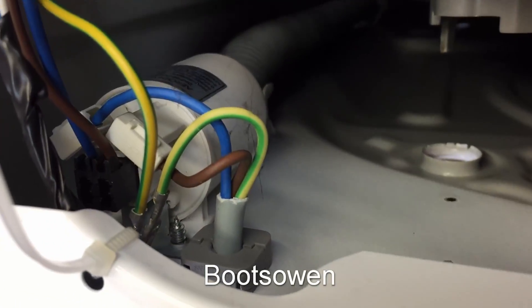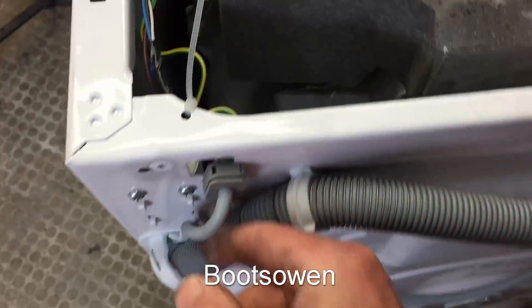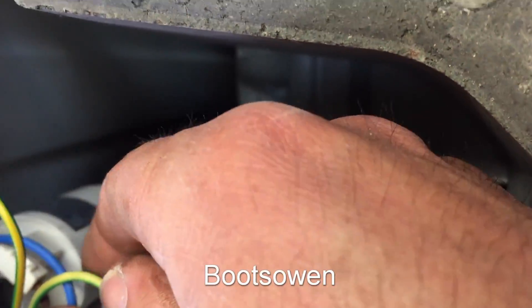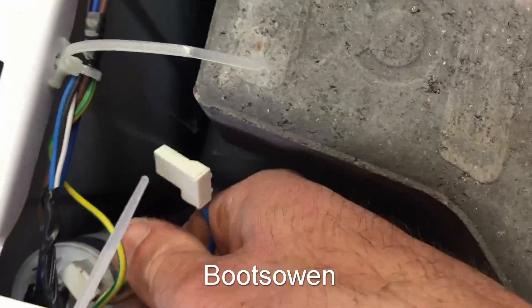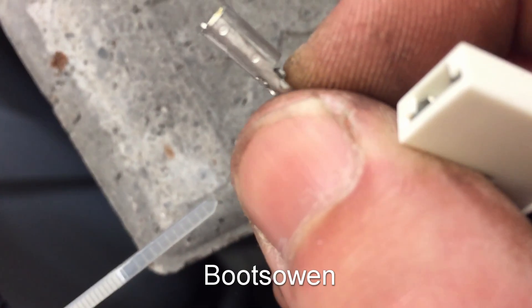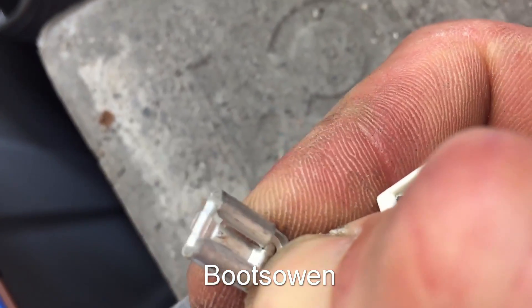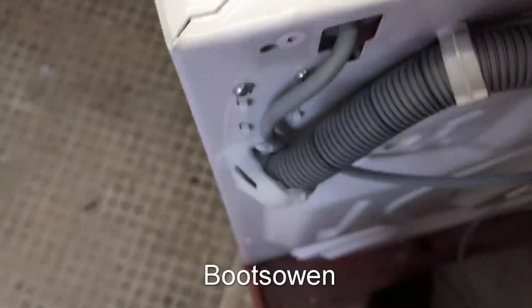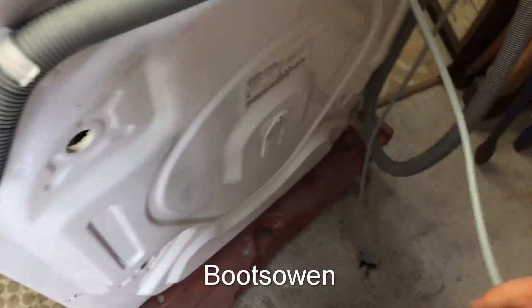So what do I need? I'd like those connectors on that piece of wire to hotwire it. I could probably just yank these off if they're not attached — so I can use that for hotwiring it. Yeah, neutral, live, and earth. The earth one has this little tiny tab on it which is going to be tricky to press off. The earth connector has this little button that you press just there, and it releases that pin in the center just a tiny bit — press it down with a screwdriver or your fingernail, and that gets that off, and that will form a major part of the hotwiring experience.